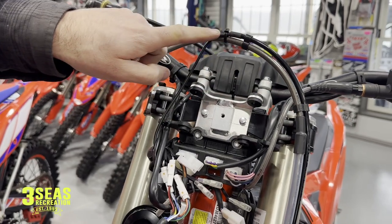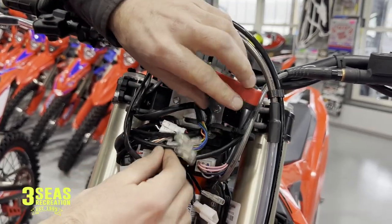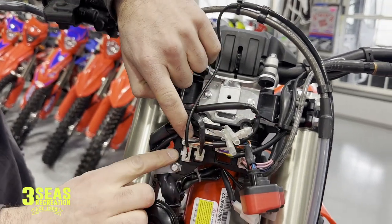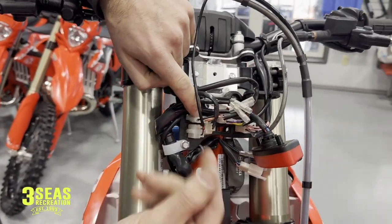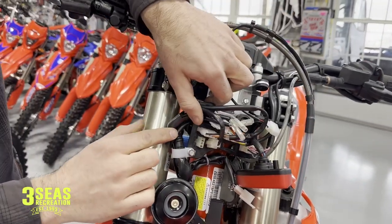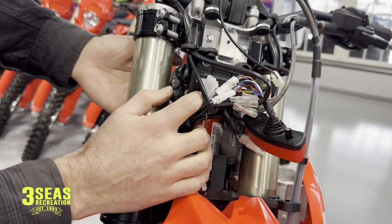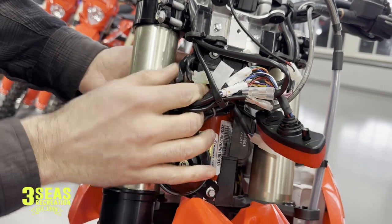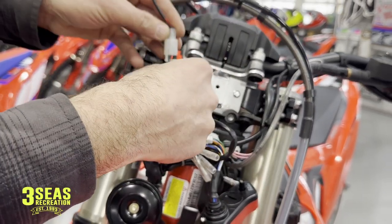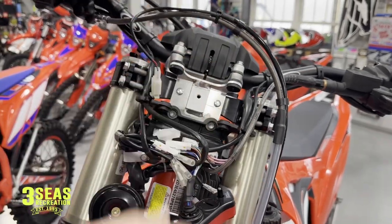Now we need to take care of our speedo cable. You can see it's pulling down a little bit — that's the one wire we're going to pop out of the black bracket. Follow the speedo wire right down — it's a two-prong connector on the right-hand side of the bike (left if you're looking straight on). Simply push in on the side of the connector and it releases. Now we're going to push it right out of the back of the bracket — there's plenty of room back there. We're going to slide it out the side, then push it straight up. That gives us the room we need to reconnect it higher up. It's actually higher than stock, so you have a lot less stress on that cable. If you come up on a jump and it pulls everything up, it's not going to hurt that cable.